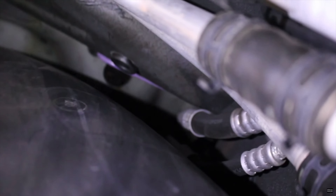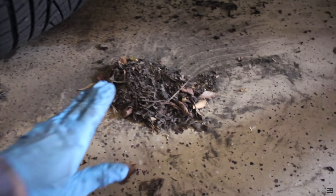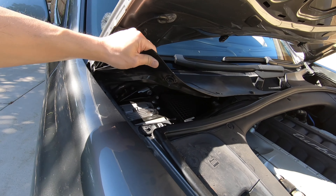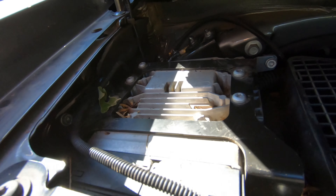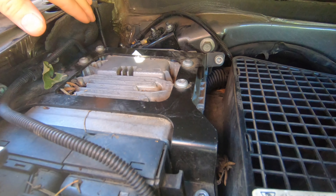While you have the drain plug off, go ahead and take a look at the hole and try to clear out the port. In my prior videos I was able to get a lot of leaves and debris out of the front cowl over here, which was creating some blockage. While you're at it, you can also clear out the cowl area by the windshield — just take off a few clips, and what you'll probably find are leaves and debris, so clean this out as well to prevent water from going into the wrong places.